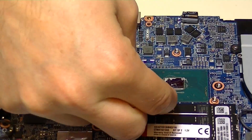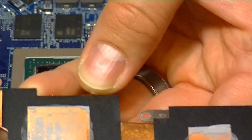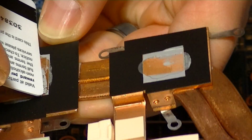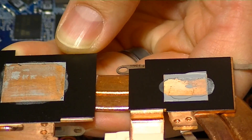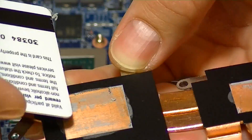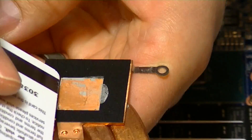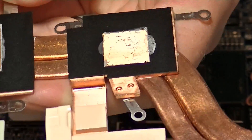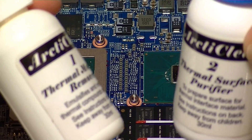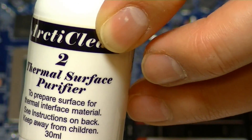If you're just trying to upgrade the thermal paste on a newer model, it will probably be more like a paste or putty as you remove it. Once you've cleaned off the GPU and CPU die, the next thing you'll need to do is clean off the heat sink itself. The reason you want these as clean as possible is to create as close a bond between the heat sink and the dies, allowing the thermal paste to be the only thing transferring heat. Old residue could create air pockets and inhibit heat transfer away from the CPU and GPU die.